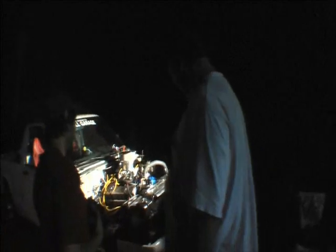It's running though, so. It started up, I didn't have to move the distributor, so I'm still getting this different disturbance. It got up to 170 sitting there? It went up to 180 and started dropping. Came back down to 170. Because the RPMs went down. It wasn't working as hard. Yeah. So I think it might be okay.